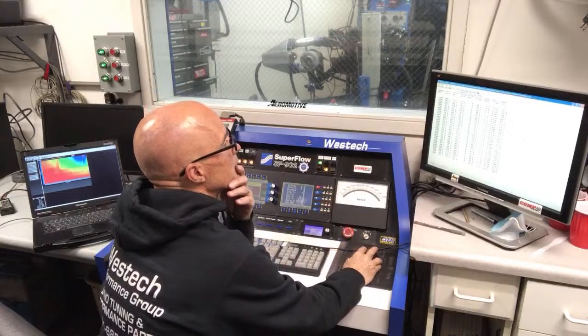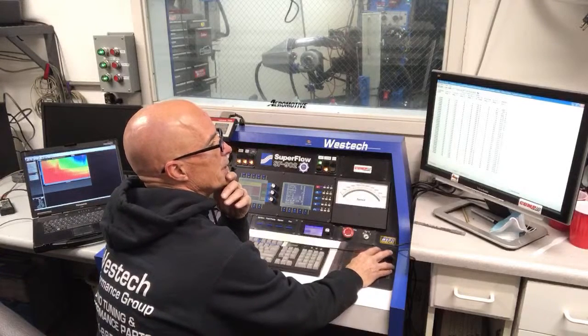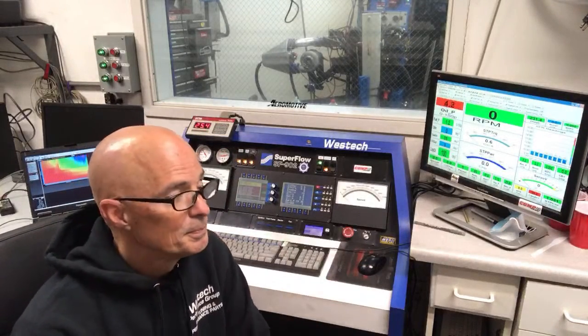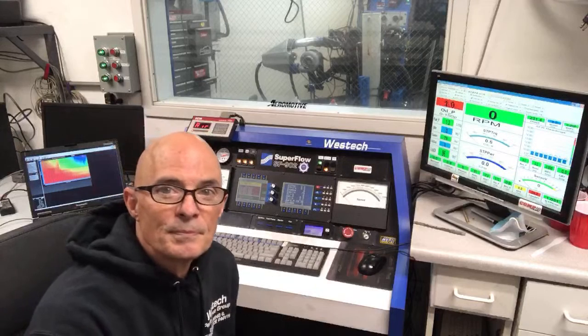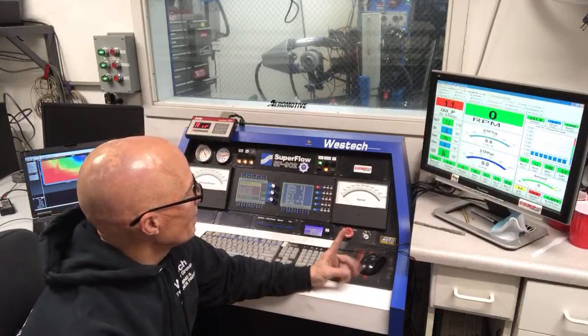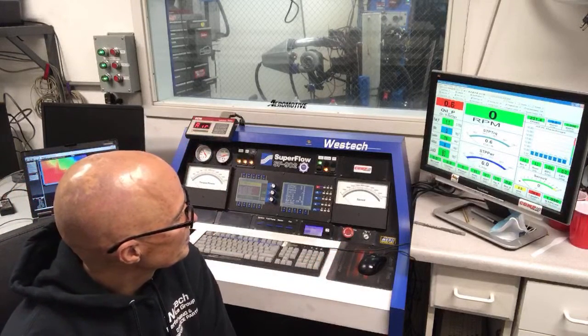And let's see here. Yeah, a whopping 82-degree inlet air temperature at 7 pounds. So it's doing good. You know, it's all good in the hood. The boost is at 7 pounds. It's just running on the wastegate. What's the water temp going into the intercooler? It is about 79 degrees. It's doing good.